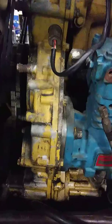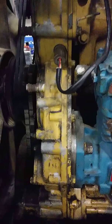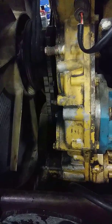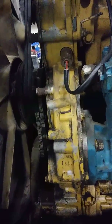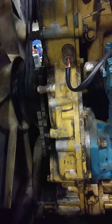I'm going to start over here with this sensor — this is a cam position sensor, it's a three-wire sensor. Basically what this sensor does is it reads the teeth on the cam sensor gear, letting the ECU know when cylinder one is at top dead center, or which cylinder is at top dead center — pretty much letting the engine know when it needs to inject fuel.